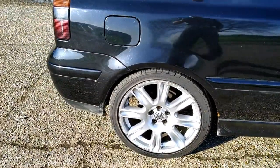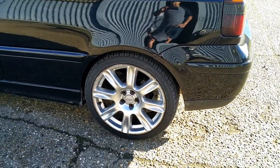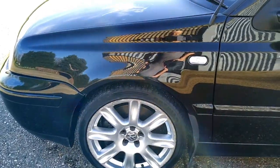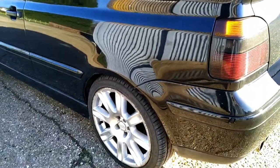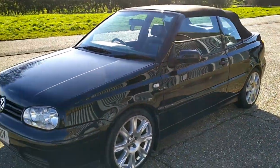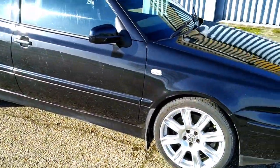The back still doesn't have the rear beam - the bushes are on order so we're going to get those to clean up and recondition that rear beam and put that on. It's currently on 215/40 17s and it rubs slightly at the front and back, so potentially thinking about going down to 205/40 17s which takes the rolling radius back to standard. It's sitting slightly lower at the back because there's a set of rims in the back - normally it sits pretty square, pretty standard, looks OEM almost, just slightly lowered. That's the look we're going for - OEM plus.